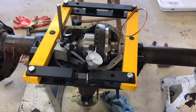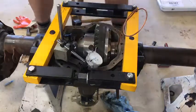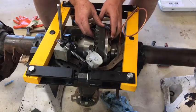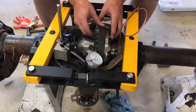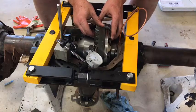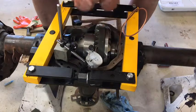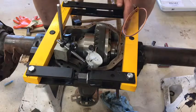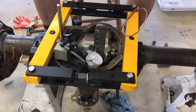I actually decided to do something a little different. I went ahead and checked my backlash before putting the shims in, because what I'm seeing is my backlash did go down. I'm not going to put that extra shim in, but it's still right on kind of the high range and I wouldn't mind if it went down another couple thousandths. So when I spread this, I'm going to put a little bit thicker shim on this side to push the ring gear over, and I think that might take a couple thousandths off my backlash.